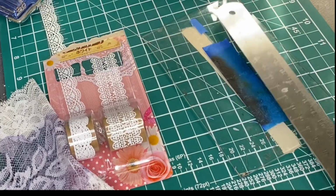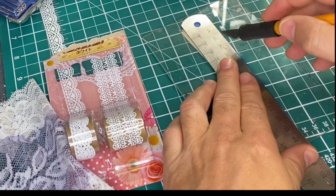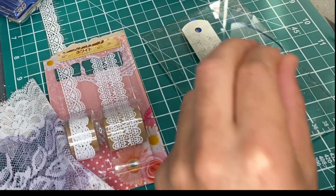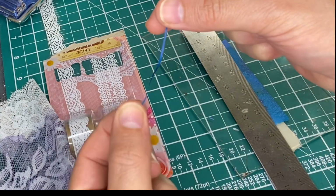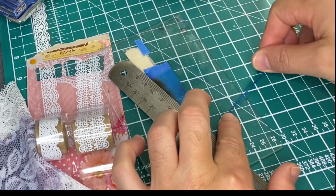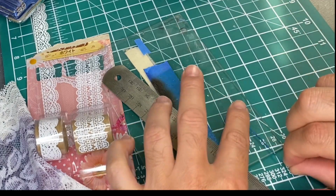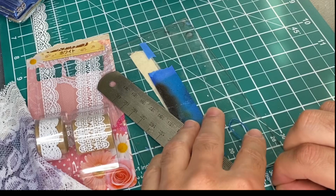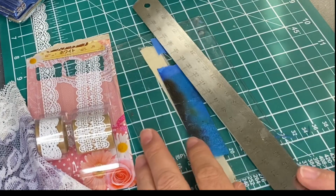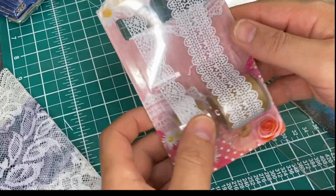Then you want to do your line work. I've shown in a few videos the glass sheet, the metal ruler, slicing the masking tape, getting your strip. So it's really the same process, and then mapping out your patterns on the car. Sometimes it's a good idea to just work with the body lines of the car and get it flowing, and then you can get into sectioning parts off and creating designs. And there's lots of great painters out there you can use as examples.